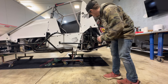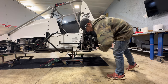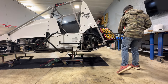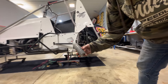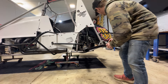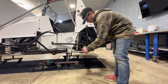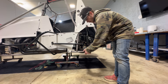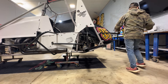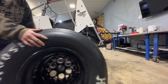One other thing I wanted to mention — you can see my nuts will free spin really, really nicely. They're not like that when you get a new axle and new nut; you're going to hear it squeak. Dry graphite — you just sprinkle it on, rotate it, sprinkle it, rotate it, get it covered, then sprinkle some into the end of the nut and work it back and forth 10-15-20 times. That'll save you a headache especially in the work area — 10 seconds can be the difference between getting back on the track or not.